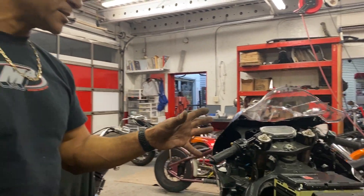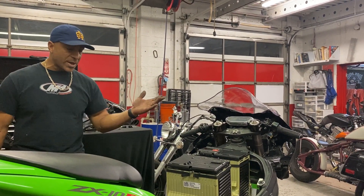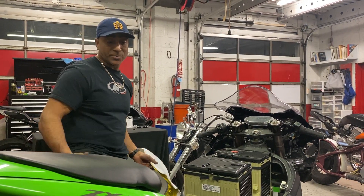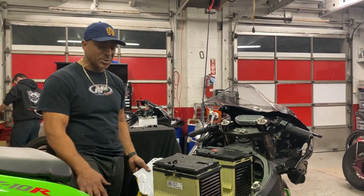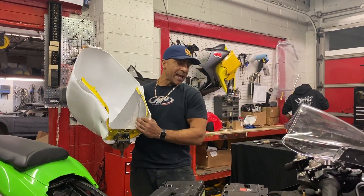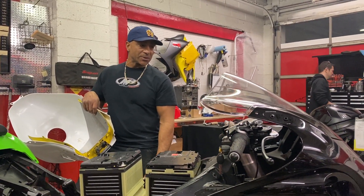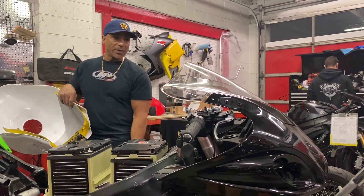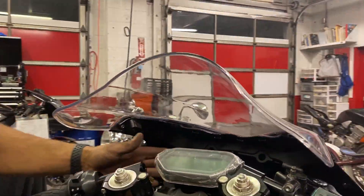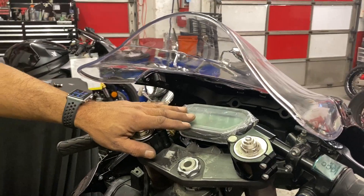The controls for the control unit, the batteries, and everything will be contained within their own harness - so the swap is self-contained with its own gauges, batteries, electronics, and drive motor. I'll make a simple harness for the bike so the factory harness can just be removed and put aside. I'm also thinking about putting a tablet in the front that we can Bluetooth - probably to monitor the batteries, or at minimum it would be a cool display alongside the digital gauges and battery sensors.